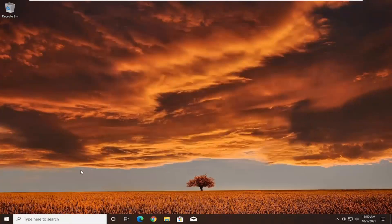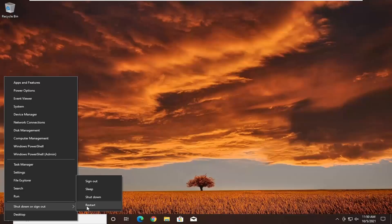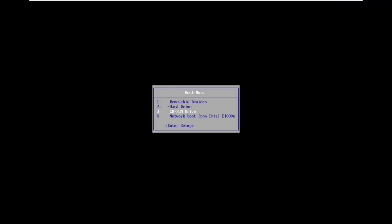Once you're done with that, close out of here, and then you're going to restart your computer and go to the boot menu. Go ahead and restart. Depending on your computer manufacturer, it might be the Escape key, F2, F8, or F12 — those are the most common ones. You want to get to the boot menu with your Windows installation media inserted, whether it be a USB flash drive or a DVD. In the boot menu, go down to whatever drive you have your files on. In my case it's on a DVD, so I'm going to select the CD-ROM drive. If you're using a USB flash drive, select that option instead. Press any key to boot from the DVD.